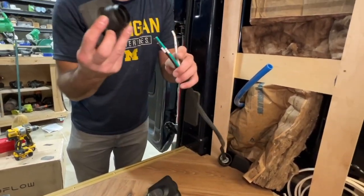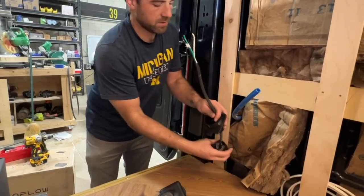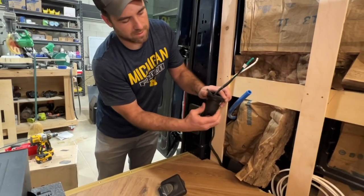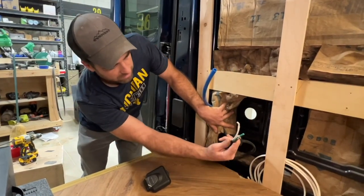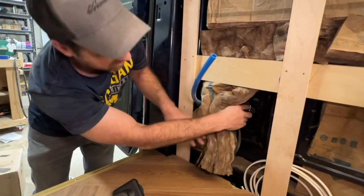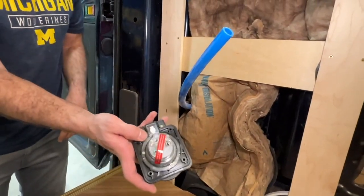Next, you will send them through this piece. And we can loosely tighten that now because we still will need some play in the wire before we finish terminating. Next, we'll send the wires through the hole that we pre-drilled for the shore power charge. And if you follow me outside, I'll show you how we terminate it into the shore power outlet.